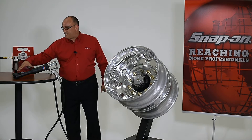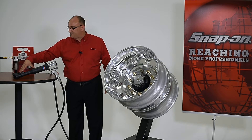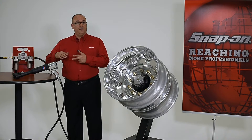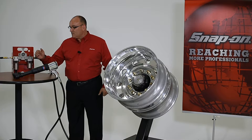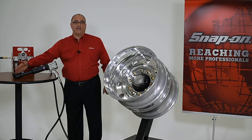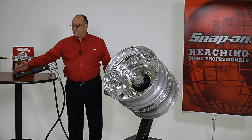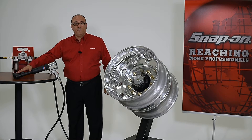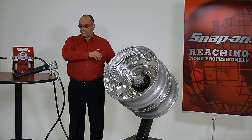I'm demonstrating this today with a 7-inch wheel torque extension. A 12-inch version is available if more reach is needed. On the extension, I have a 12-point impact socket that's sized for the lug nut and the appropriately sized reaction cup. Six-point sockets could be used, but I use 12-point because it makes alignment of the tool easier.